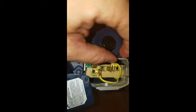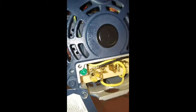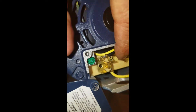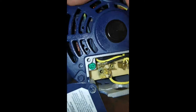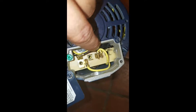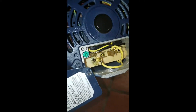I went ahead and wired it up for low voltage. So this first one here in the first terminal — that is P1, then you got P2. On number two it's T3 — so that's P1, P2, T3, left blank. You see a black wire here, and this is actually T2 — T as in Tom, two. Then you're going to put L1 here and L2 from your lines from the fryer.